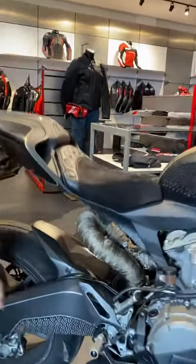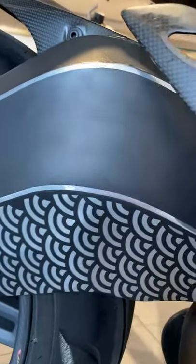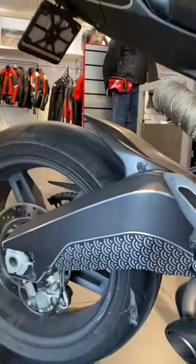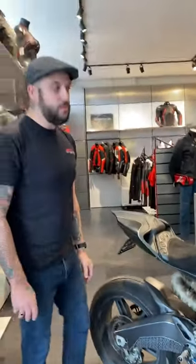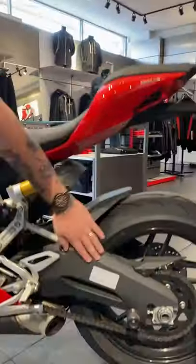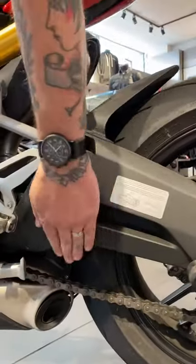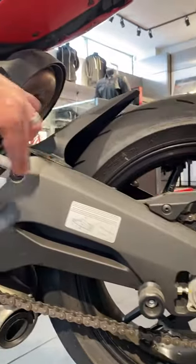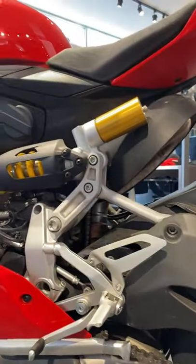The raw silver is going to be on this swingarm here — it's probably one of my favorite parts. On the stock swingarm there's a pocket right here; we welded that up and polished the whole thing down, so all that detail work you're seeing is raw aluminum. This section got filled in, this whole piece got polished out, all this wrap texture is only staying on the top, and all of this got blacked out to match it.